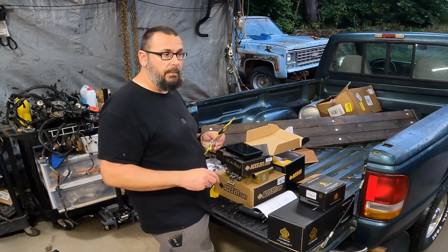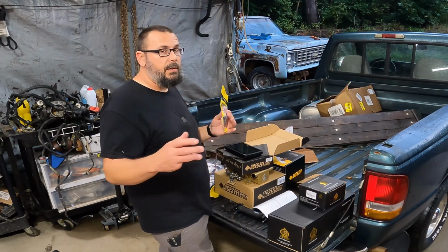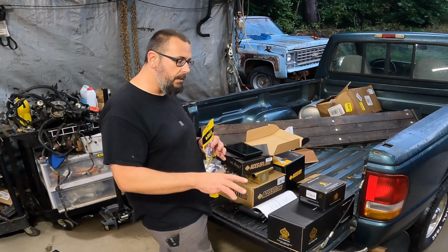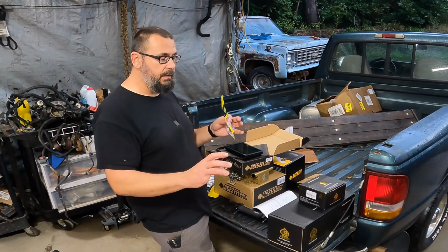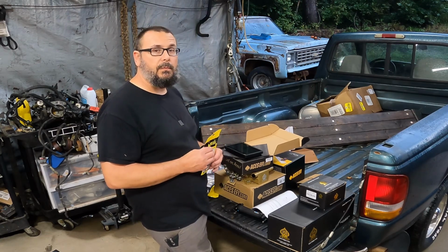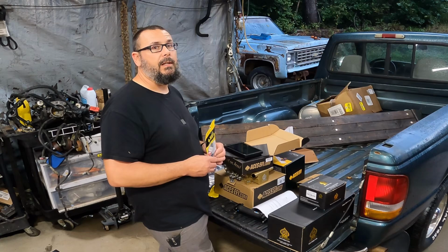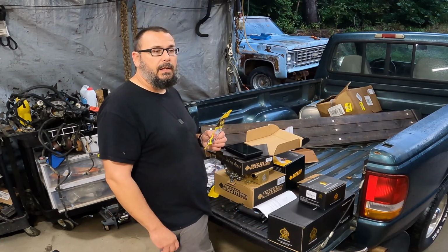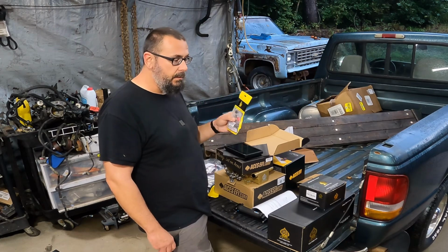Joe's car, the El Camino, I had like 140 pounds of pressure, which was blowing injectors open, making them stay open, tearing them up, which led to a hydrolock motor and a detonation that broke a connecting rod, busted the block. So from now on, if I don't know fuel pressure, it ain't gonna run.